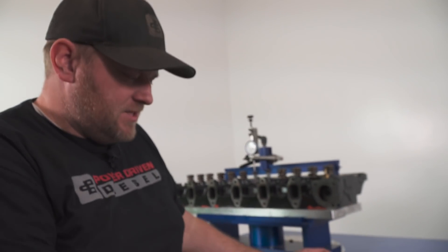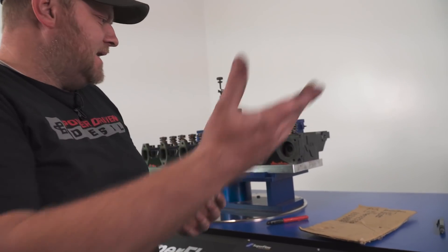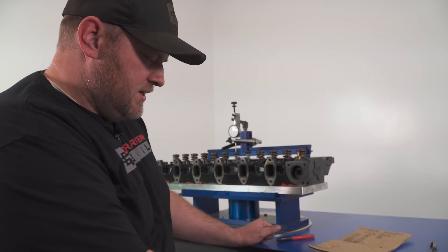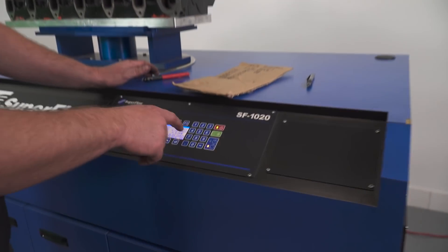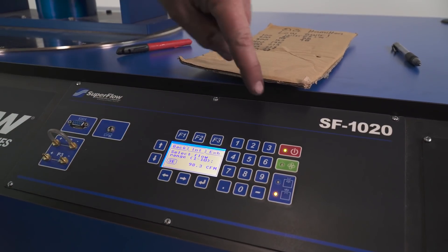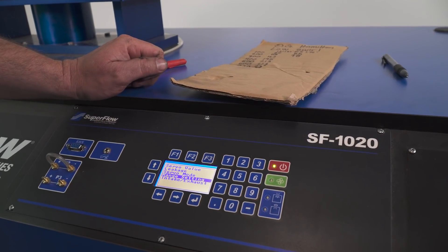Okay, so now we have to step up a range. This range can only flow up to 97 CFM, but the bench has multiple ranges to give the most accuracy. If you test the same thing on the highest setting it might read 95 CFM, so you can lose two or three CFM depending on what range you're on. The machine clicked an arrow telling us to go up a range. We were on range three — there are nine ranges total. Let's go to range five, which goes all the way up to 195 CFM. Now it's moving orifices around in the machine.